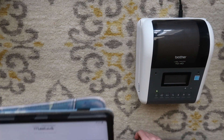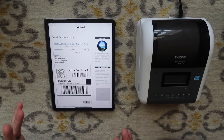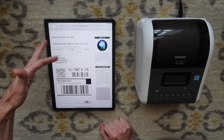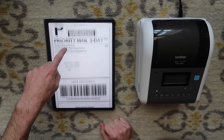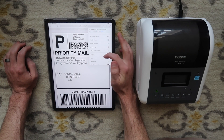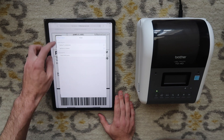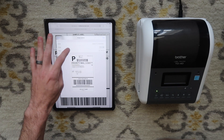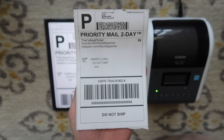Now that the printer is on the network, we're going to go to the iPad. You want to make sure you're on the same network as your printer — same home network, otherwise it's not going to work. We're on fulfilledmerchant.com. I have a 4x6 sample label here to print — it's free, I will put a link in the description. You just click download, it brings you to a sample label. Go up here, there's a square with an up arrow, press that, scroll down to print, go to printer, and the Brother TD4550DNWB should pop up. Everything looks good — you're going to hit print and it's going to print you a beautiful 4x6 shipping label.